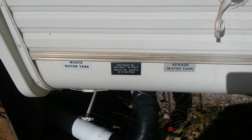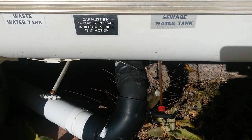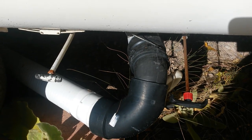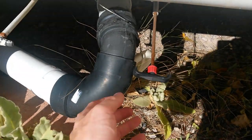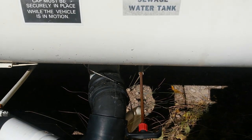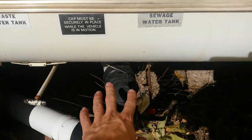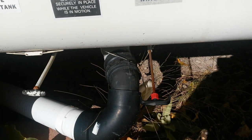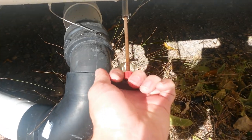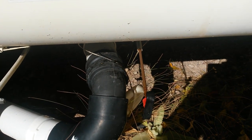What you can do is get an RV flushing wand — it's basically a straight one with a little spinning end. You attach a hose to it, stick it down your toilet and turn it on. Go ahead and flush your black water tank for a good 20-30 minutes to get every bit of debris or toilet paper out of there. What you don't want is for that fecal matter and toilet paper to harden and solidify in your black water tank and especially around your blade valve. They actually call it a poor man's concrete because once it dries and hardens it doesn't dissolve easily. If that stuff hardens around the seal of your blade valve, it's going to sit open for the winter. When you go to use it again in summer, you'll just push hardened material into the seal and end up with a leaking or failed blade valve altogether.